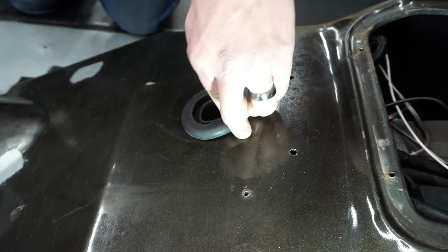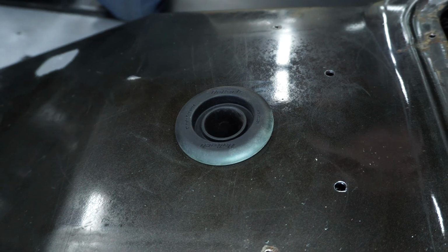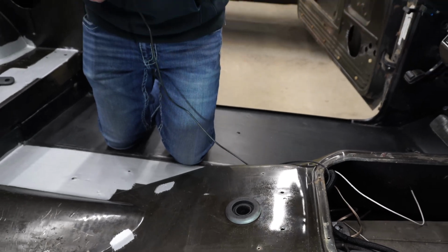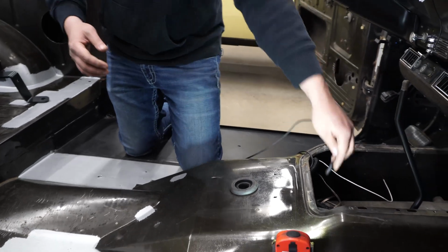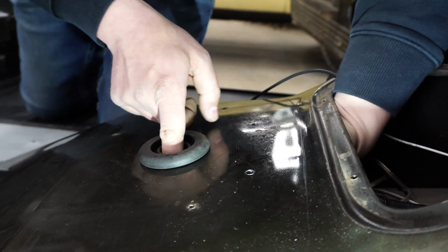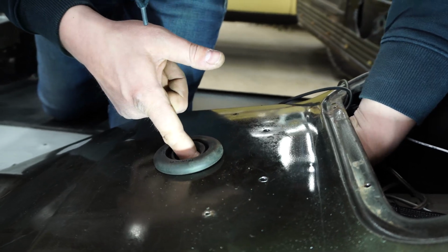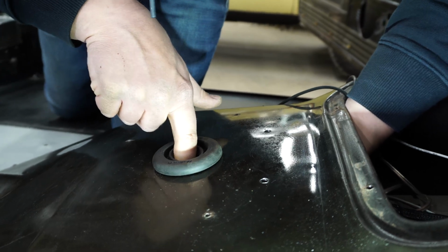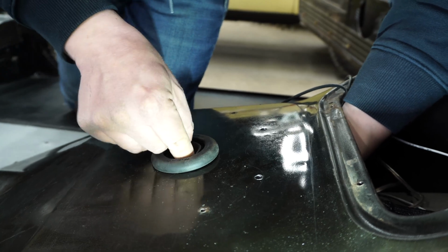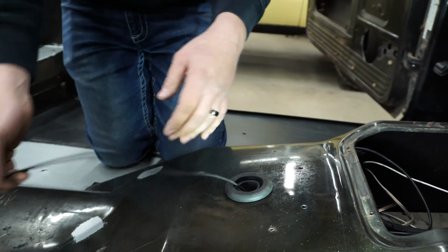Now the main wiring that we run through here on every truck, any truck that's getting a stereo system will have a USB input. I usually run the 10-foot extension from the dash down the tunnel area, and that'll come up through this grommet and into the console. That's where having the bigger hole is nice to get these ends through.